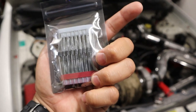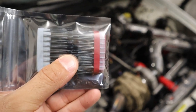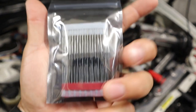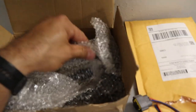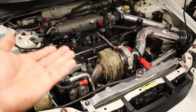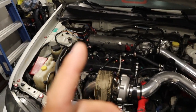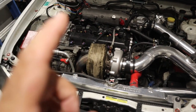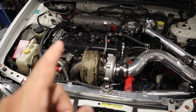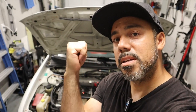These diodes pretty much just protect the coil packs — all they do is lower the voltage that passes through, and that way you won't burn them again. For the meantime, I didn't know if all four would be bad, so I went ahead and bought four cheap ones just to test. If everything goes well, I'll put the Hitachi name brands back on, because these were pretty much brand new — not even one month of driving on them.